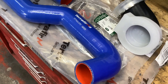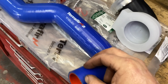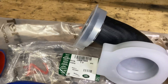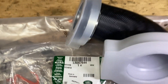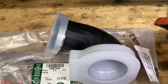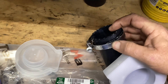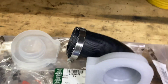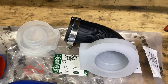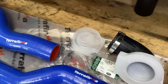I know some kits — I don't know the brand — but if it's a right-hand-drive vehicle you've got to trim a bit off. Why can't you just make the kit right? That's the elbow — that's the part number for the elbow. The genuine one has clamps on it that are attached and they bite really well. I've had ones in the past where someone replaced it with something else and the clamps were leaking, so it was still getting that same fault.